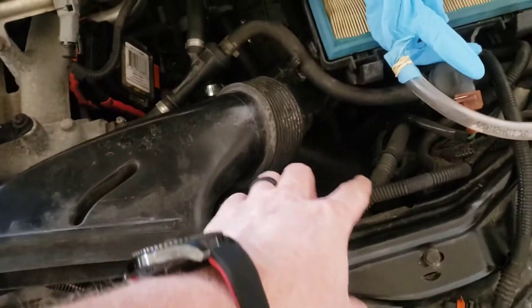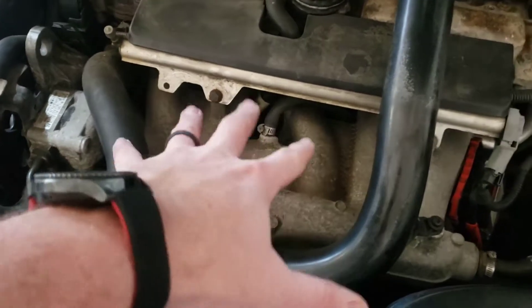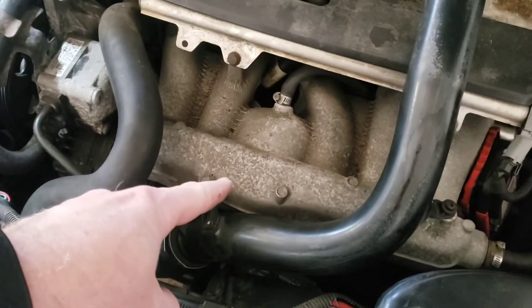I'm going to dig into this a little bit more and see what's going on and figure out where it's at. I had the intercooler tube off of this side here and it connects under here to the throttle body. I'd have to take all this apart to see - I think because I had this side off, it might have loosened the connection on the other side. The cigar trick worked - pushing smoke through the system allowed me to pinpoint the massive leak, which was at the throttle body underneath the intake plenum.